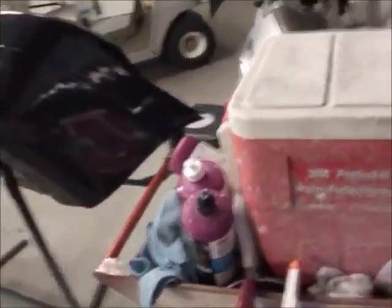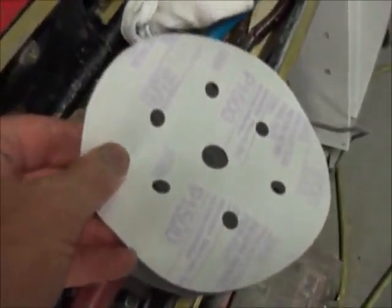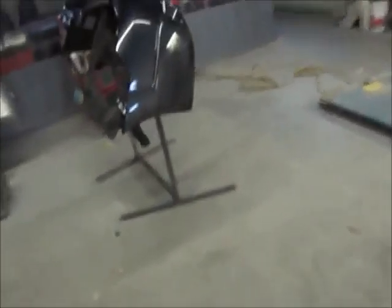So for that Cadillac Monday, I'm probably gonna go a little overkill with the sanding and polishing, but I'll end up with a nice swirl-free job. I'm gonna start with P1500, this type of paper from 3M. I skim over it with the DA. I use this DA over here with the interface pad on it. It's more like a finished DA. And just skim over it quick, and then you can see where the dust is, and you go after the dust a little more and skim over it again.